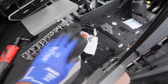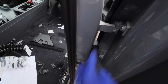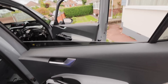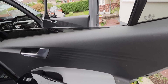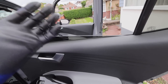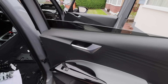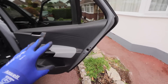These are the tools we're going to use to take off the door card - special sockets and the official VW door card removal tools. I'm deciding whether to have the window up or down. I think having it up is better because when we take the card away we can unclick the mirror and window controls, then drop it down.